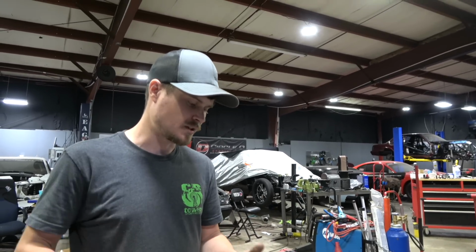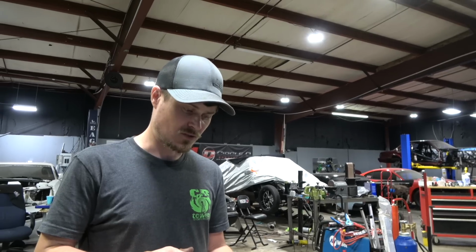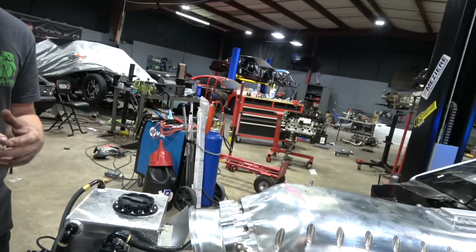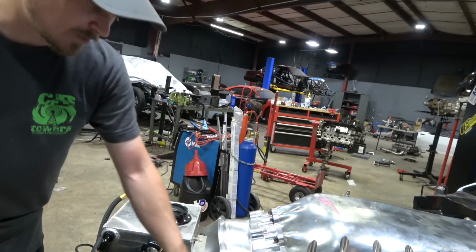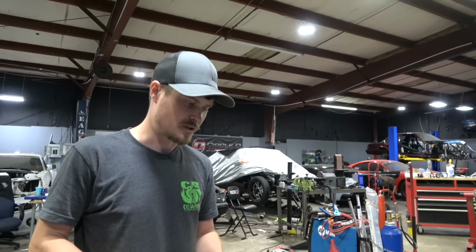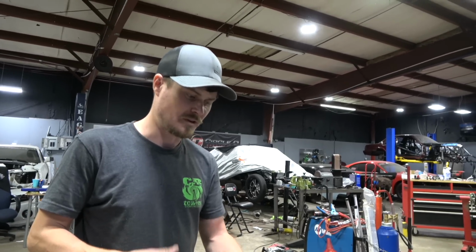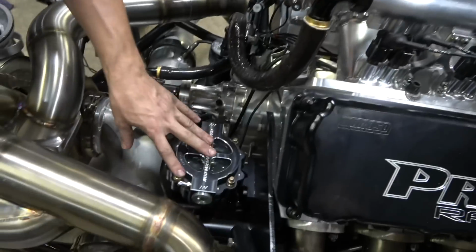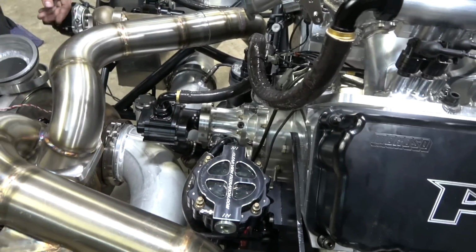We have crank sync. I think everything's good on our 60 degrees and 185. Pretty sure. Is everything tight? Yeah, everything's in there. The cam sync was already installed by Proline, and the degree wheel, everything seems like it's in the correct location. So I think we're actually ready. Clear view right here, these 4 bolts are actually loose. Slight oil leak, which is why you really pay attention. Yeah, that's why you prime.